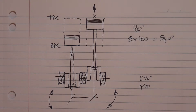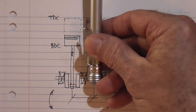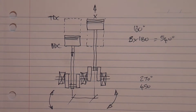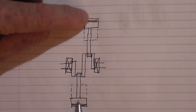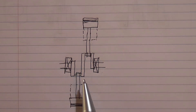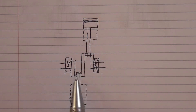So if you were to develop a flat engine from the 180-degree parallel twin, what you would do is swing this cylinder and piston over 180 degrees. This is the typical arrangement for a boxer twin. What you've got is both pistons moving out together and in together, completely in phase, and that means that the primary and secondary forces are always completely balanced. However, you do end up with a rocking couple because the pistons and conrods are not in alignment.